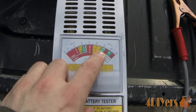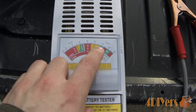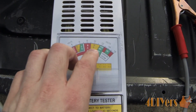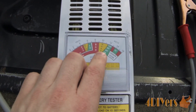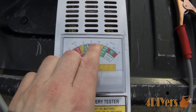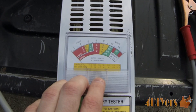On the tester you can see there is a green bar showing the cranking amperage of the battery — it shows 1,800, 600, and 400. Once the needle drops into the yellow area, the battery is determined to be weak. And if the voltage drops all the way down below 9.6 volts, that means the battery is no good and will need to be replaced.